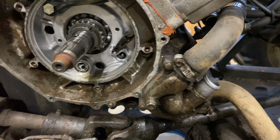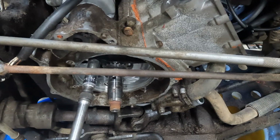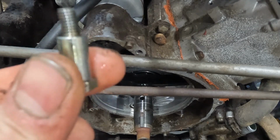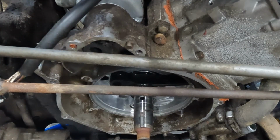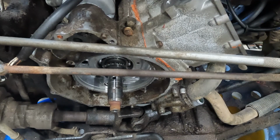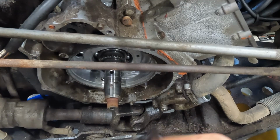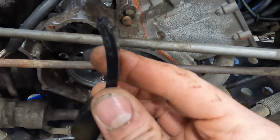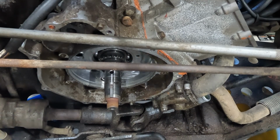And we're just gonna proceed with caution. Oh, hey, I think the bolt is just bent. That thing is winging around like that. The bolt came out. You can see it's bent, so I'm gonna have to figure out another one of those. Which that's from that chain wrapping up in there. I think the guide's usable. There's a little chip out of it here. I'm gonna roll with it. I think it's gonna be okay. The way it looked when I took it apart, the chain doesn't really ride. It kind of tapers off right there. The chain will ride on this part, so I'm just gonna push ahead.